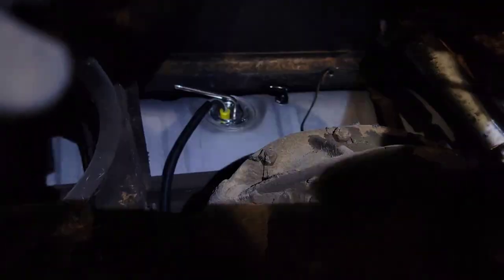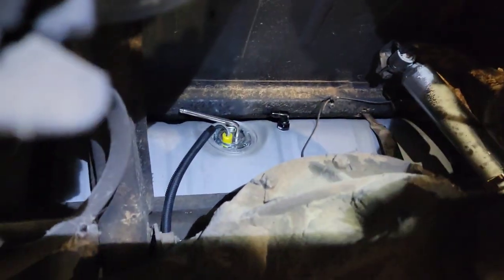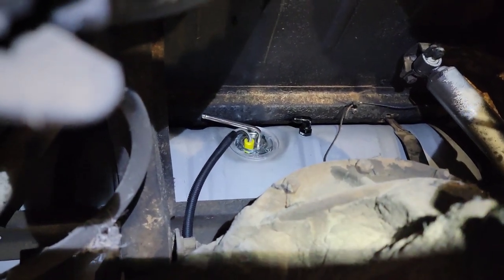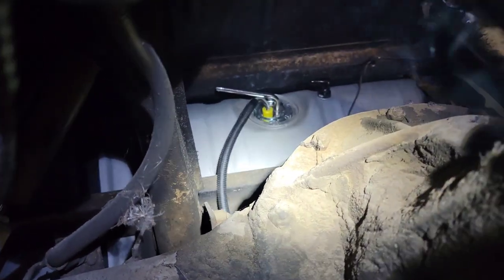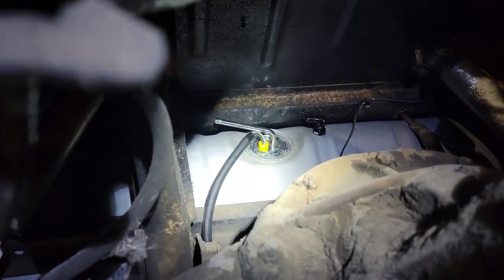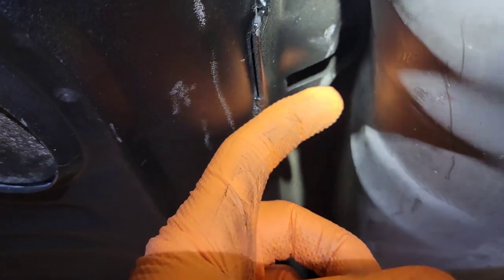I am a cheater and I use my jack stand for holding up the gas tank. This tank is a weird one and mounts differently. On the right is the return line, and on the left with the 90-degree snout is our new fuel pump. The black corrugated is the new wiring for it, which we're going to make our own pigtail since this comes from a new EFI system. As I said before, make sure you've got ground to the body and a direct ground to the unit. We're missing the bolts for the straps — I'll run about a three or four-inch bolt through that hole. It has a little clasp that holds down just enough tension.